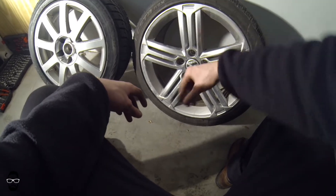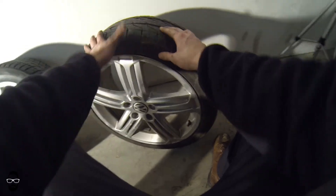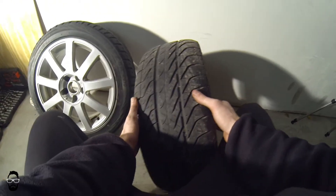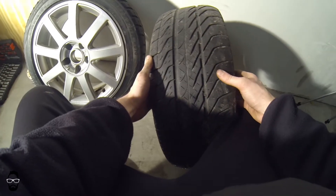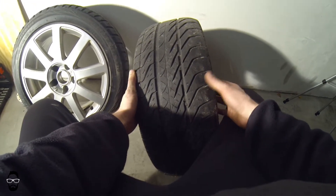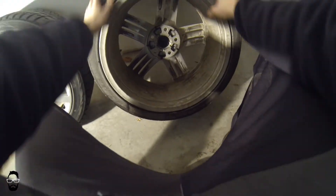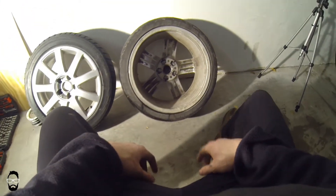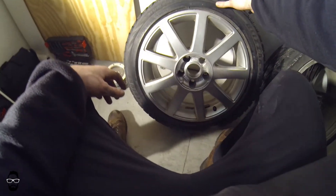The first thing you might notice is the overall diameter. The Talladegas are 18-inch wheels and the Celebrations are only 17 inches. I would have bought smaller wheels for my winter wheels, but the barrel diameter on 16-inch wheels and lower is too small to clear the brake calipers on the Golf R. So if you're driving a Mark 6 Golf R, it's got to be 17 inches or up. But if you are driving a Mark 6 GTI, you're good to go with 16-inch diameter wheels.